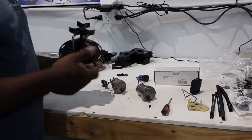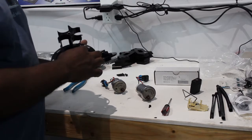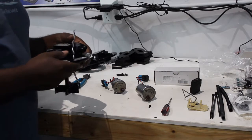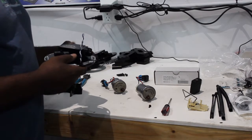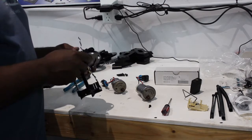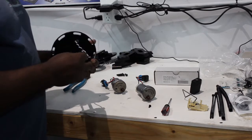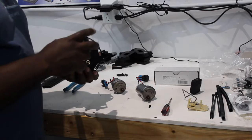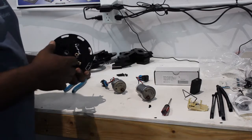It's a pretty simple unit, single cavity, up to three pumps. The standard fittings we give you are pretty much set up for the larger Walbros — the Hellcat 525, the 485, the 450s. Those pumps carry inch-and-a-half bodies, and the lower bases are a little bit larger with a turbine impeller for the higher flow.